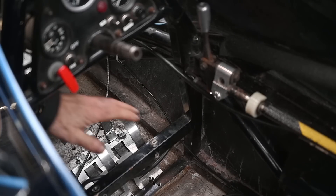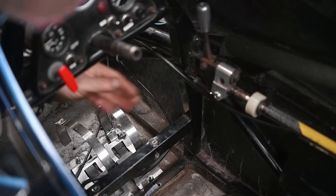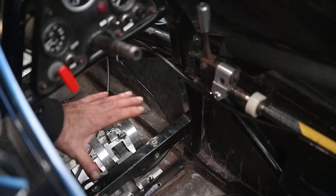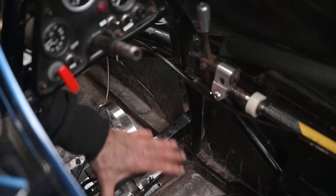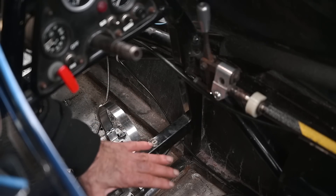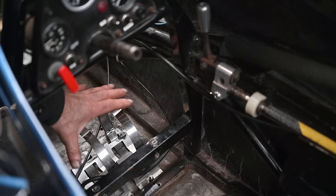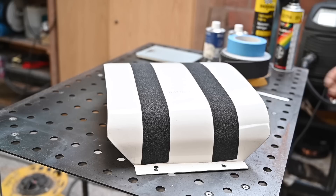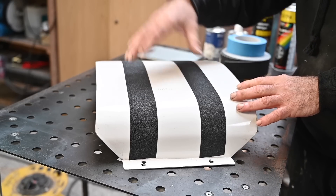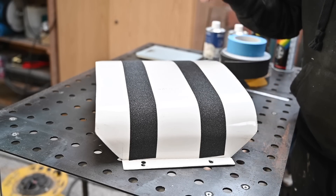You can see that with the battery here and the fire extinguisher here, there isn't a lot of space in this opening for your legs to come through. The steering rod also goes down through the area, so it's really squeezing things. So I prepared an aluminum panel that goes over all of this — over both the battery and the fire extinguisher — which will allow my feet not to get caught. Let me show you how that fits before we start installing the battery, bracket, and fire extinguisher.